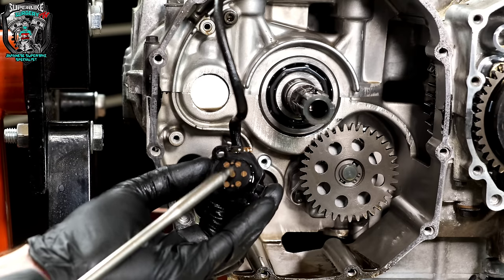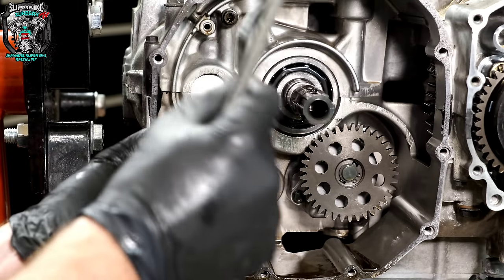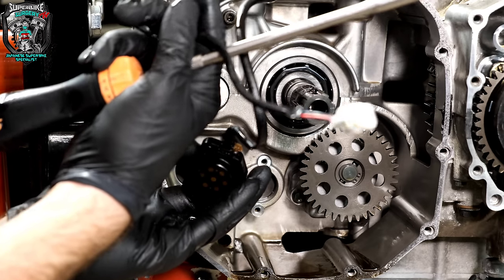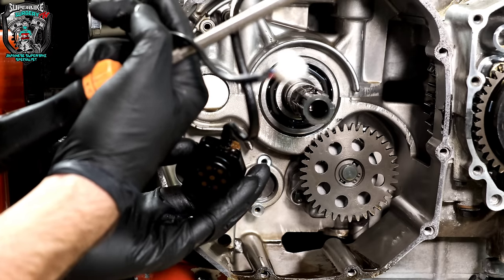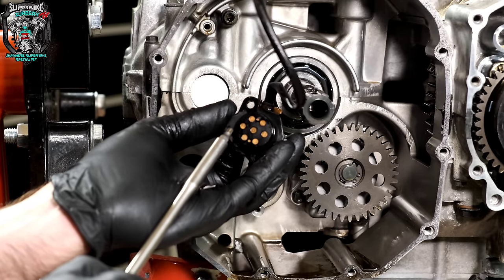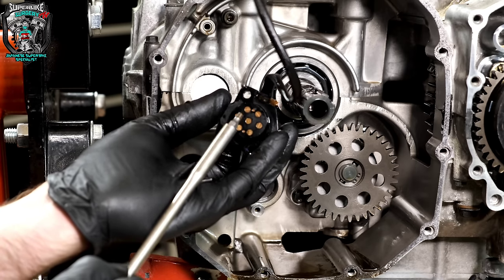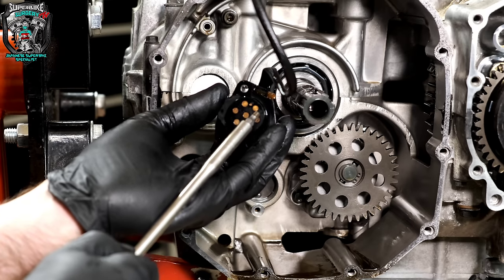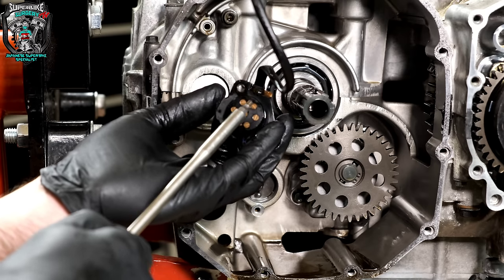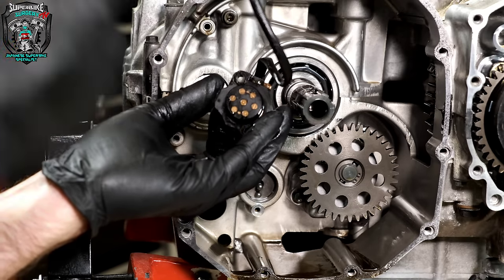Six gears, six positions, and a neutral. This centre pole is ground. One wire is ground, one is live — actually it might be a five volt reference. I think the ECU feeds five volts to this plug on one wire, there's a ground wire, and then there's an output wire. For every gear position, you're getting a slightly different voltage output. It basically shorts to ground and varies the voltage on the output wire. That's your gear position switch.